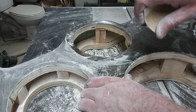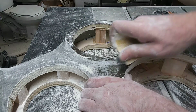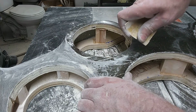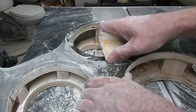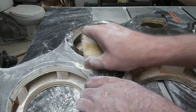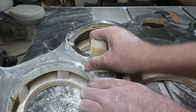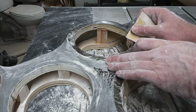As you're sanding, you'll do this rotation with your body, and you actually sand in that curve, and you keep that exact rotation, like right like this. You just keep rolling like that. So see down in here, I just brought it up to this to meet what I'm sanding. I'm going to roll my thumb right here. Keep it curved. You've got to constantly feel it too.